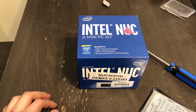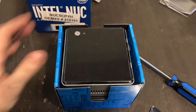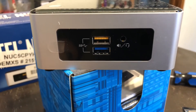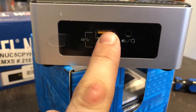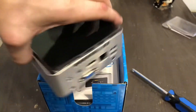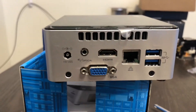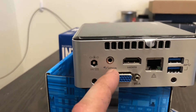Up to eight gigabytes in memory capacity. I bought this open box so it's not in perfect condition. On top we have the NUC PC itself. On the front you see audio out — just a traditional eighth-inch mini jack, no optical. There are two USB 3.0 ports on the front, color-coded for power-live versus on-only. On the back there are two more USB 3.0 ports, gigabit Ethernet, and an HDMI port which supports 4K — it might support HDR, we'll find out.